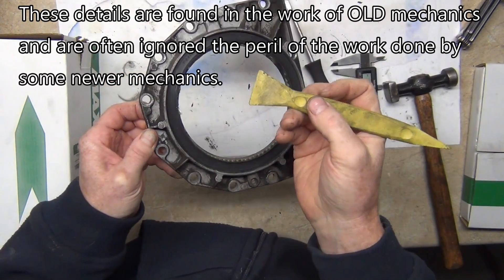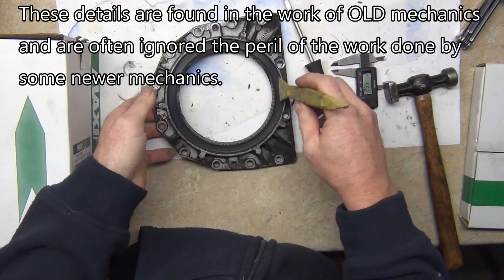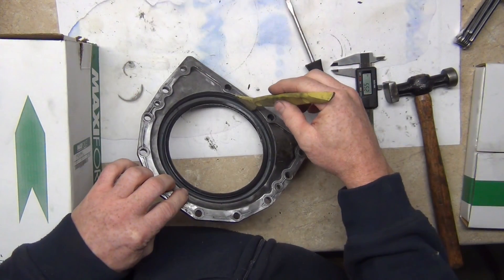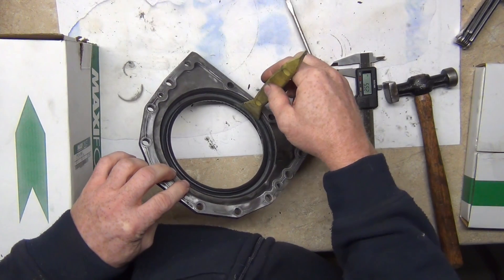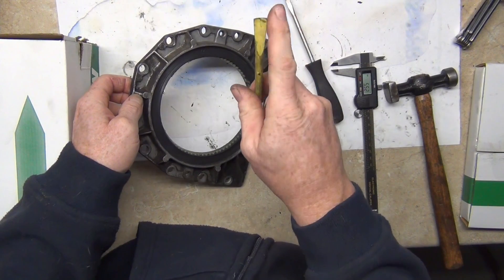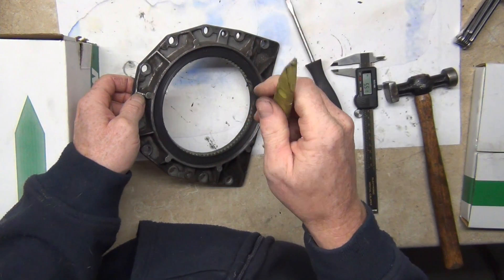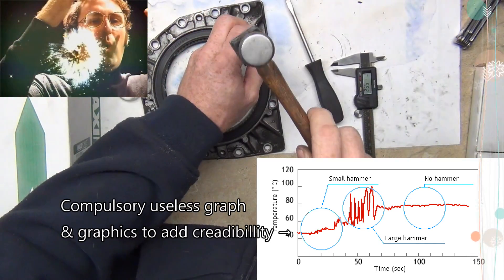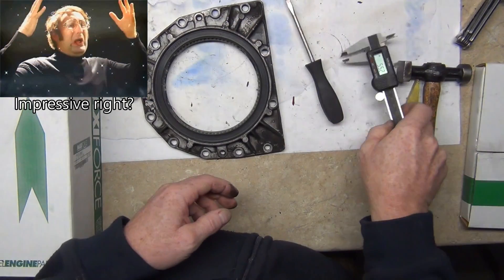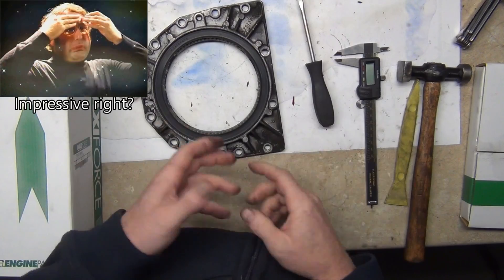What I did is I took one of these plastic body panel knives — that distributes the load but gets it right on the lip, right on the end where you have all of this reinforcement there. So I either go inside here in the corner or inside here in the corner. I just work it with a hammer — little taps. I'm not going to move it now because I got it perfect; I don't want to change that. But that's how I got it.